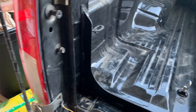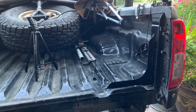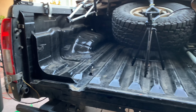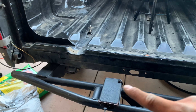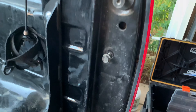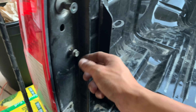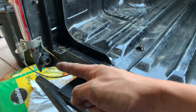I got these installed and the lights hooked back up — pretty stoked with how they look. Very low profile, not very noticeable, and hopefully with the boxes there I can still fit a mountain bike on each side. I wound up taking the tailgate off because it was just easier to get under the bolts by myself. If you've never taken your tailgate off, you just remove the one bolt with the holder, unhook the hinge, rotate the tailgate up, and pull it straight out — it's not bolted in beyond those two points.